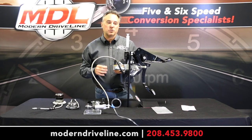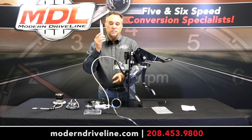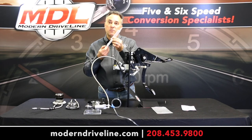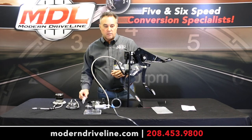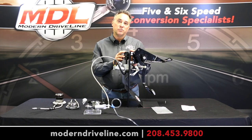Be sure your catch can is not tight around the vinyl tubing at the bottom, because that will create back pressure — you don't want to force air back into the system. Filling your syringe is like filling this entire system twice because of the amount of volume it has, between 35 and 40cc's. Hope this helps you in your endeavor with all of our modern driveline hydraulic cylinder products. Thanks for watching.